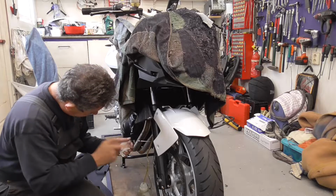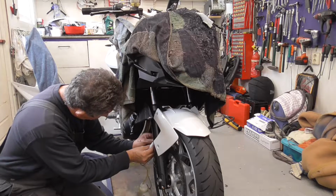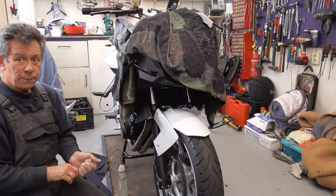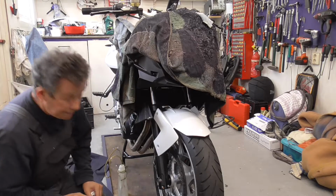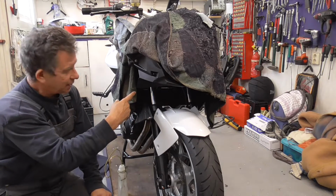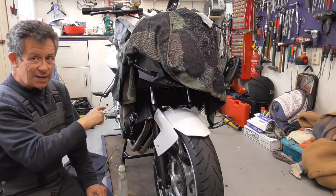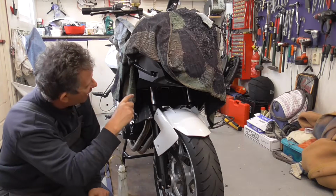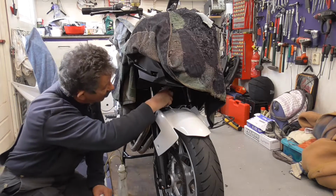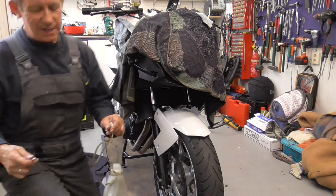Carefully, first be sure that it's closed, and then wiggle it off while holding it upright. Now, I'm gonna do the other side, but because it has this splitter over there, while I was pumping, the new fluid is already in the ABS unit. So all I have to do now is get new fluid in this line from here to the caliper. Easy, same as over here.